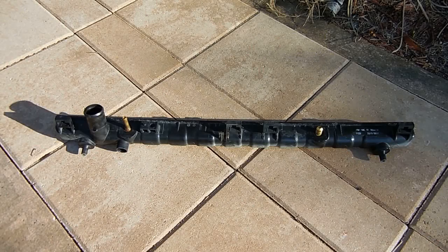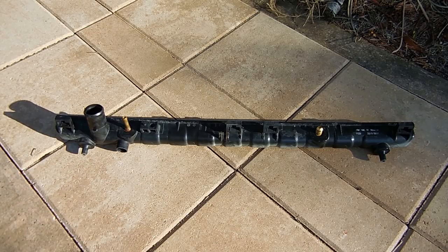Welcome back. Today's going to be a short but very interesting video. Recently I replaced the radiator in my car because the core of the radiator developed a coolant leak. After the radiator was removed, I decided to open up the lower portion of the radiator, which you can see right here, which appears to be made of a reinforced black plastic — probably nylon, because ABS has a maximum temperature rating of only 220 degrees Fahrenheit.